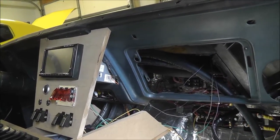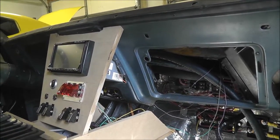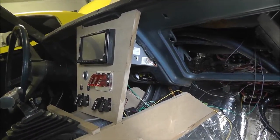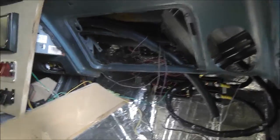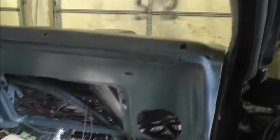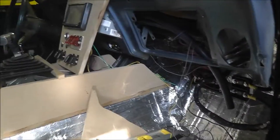Basically try the fleece wrap over the section and then use resin to harden it up. Before I can wrap the resin, I need to build a small structure frame in behind that panel, so this top panel can be removable separate from the dash, and then a couple maybe molded areas down here near the bottom where I can connect the fleece to. And then once I wrap it all the way down, it'll give me the shape I'm looking for, hopefully. So I'm going to try it on the back section first.